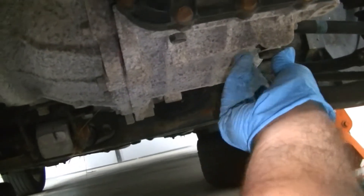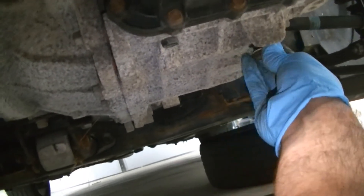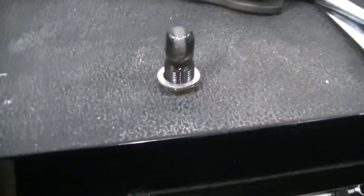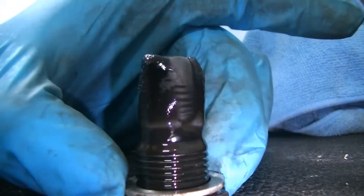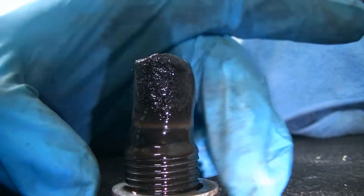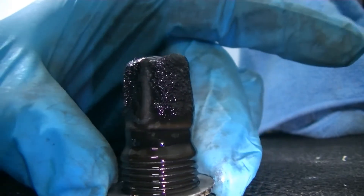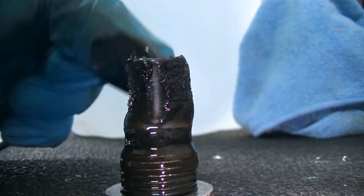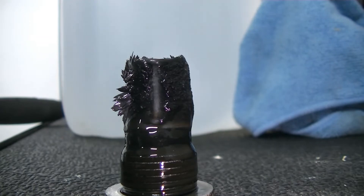We went ahead and cracked it loose. There is going to be a little crush washer on there that you do not want to lose, so very carefully take this off. Let's get our magnet and inspect it. This is pretty par for the course on one of these magnets — you're always going to expect to see some sort of magnetic fuzz on there. It's the nature of an automatic transmission; the clutch packs wear on steel plates and do create metal. You just want to feel it and make sure you don't feel any big metal chunks. If you don't, you're good — take your shop rag and wipe it off nice and clean.